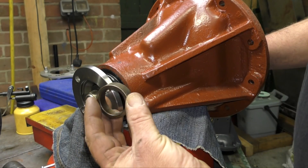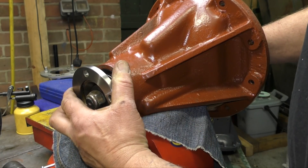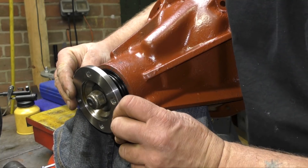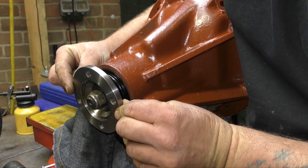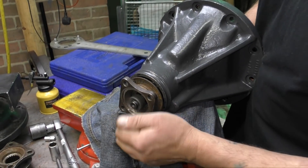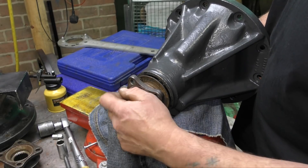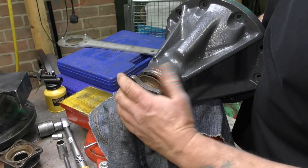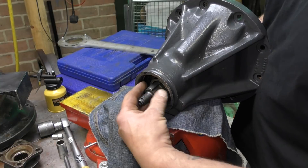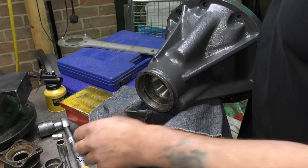This one is from the kit I've shown you before, taking the spacer out and not having the nut done up too tight. I've got the right feeling, but because the nut's not done up, the flange is not clamping the bearing properly. This is what you need to be aware of — it has to be tight, otherwise you are going to run into big issues. I'm going to keep trying at this, and to be honest, I'm in the same boat as you — I just have to keep trying.